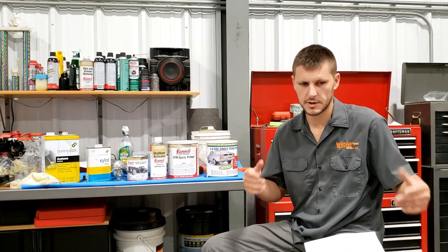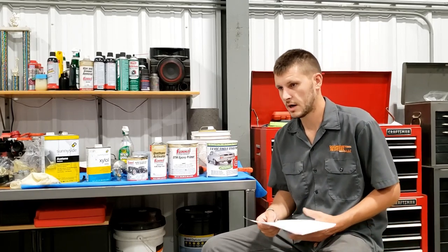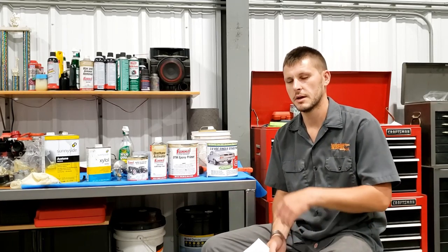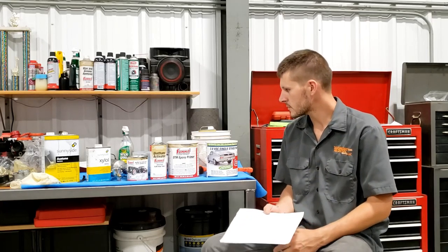And I've gotten a lot of individual brackets and automotive parts throughout the years that had different systems of powder coat applied. Some of them I was able to spray paint over and it stuck just fine. And other ones I sprayed paint over and the spray paint bubbled up and there was a reaction there and it was not pretty. So I didn't want to risk blowing $500 on that and the time to completely disassemble the frame. So powder coating went out the window.